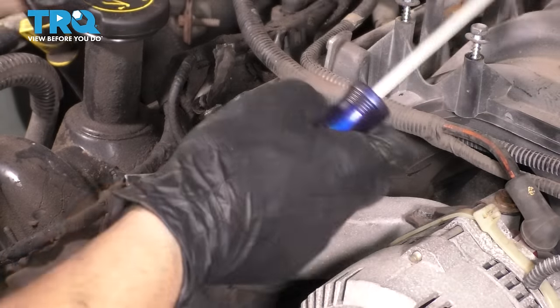So this is the power steering reservoir. It has this bracket that goes all the way down. This is what we want to unbolt. And now through the driver's side wheel well, I want to remove these two bolts over here, which I mentioned from above are the ones for the power steering reservoir. They're gonna be pretty difficult to get to, and I'm gonna start with the one that you see first. Okay, let's give this a shot. 18 millimeter socket.